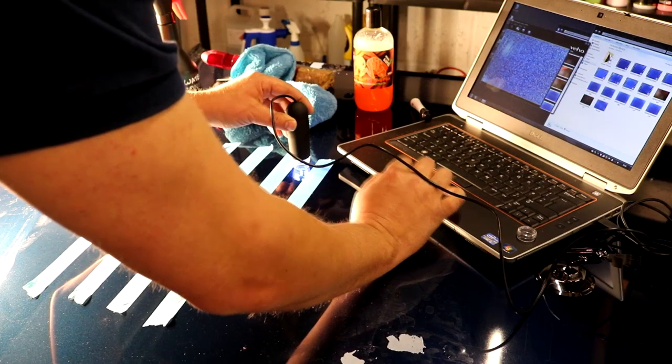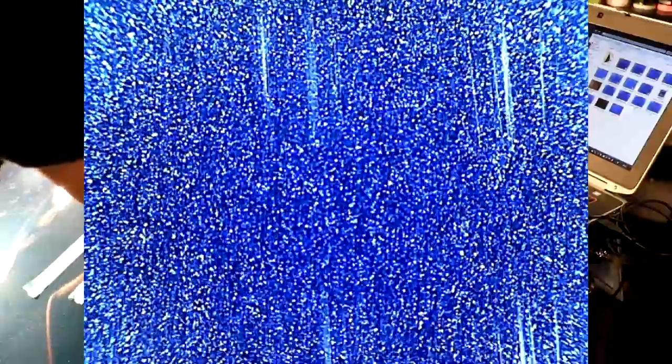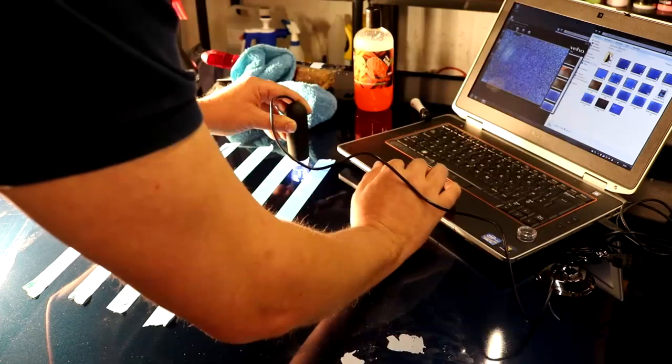Will claying scratch my car? Yes, it will. When you remove contaminants off the car you're dragging them over the clear coat, and those contaminants will scratch the car. The industry prefers the word 'marring' because it's hard to sell a product that says it will scratch your car — a lot of packaging won't even mention it. But yes, it will scratch the surface. The clay bars themselves also have the ability to mar the surface depending on paint softness, how aggressive you are, and how much contamination there is.